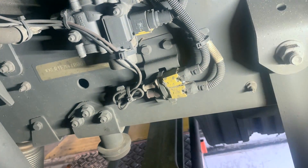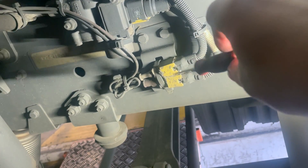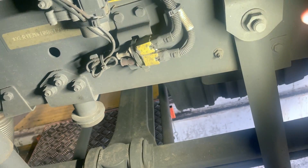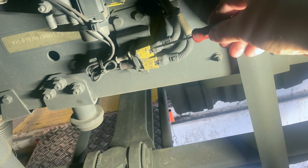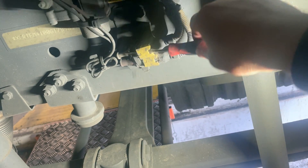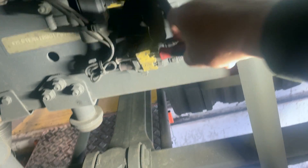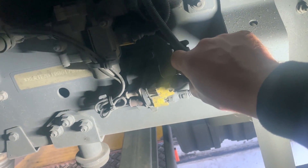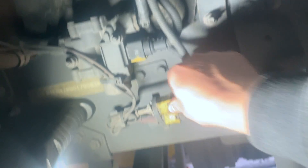Someone mentioned how some connectors come off. I'll show you this one — it's quite a common connector. The oil pressure sensor is a twist one. But for this connector, get yourself a small electrical screwdriver, and all you do is just literally pull it off, like so. Quite simple. Then just push it back on, push it all the way on, and push back in like so.